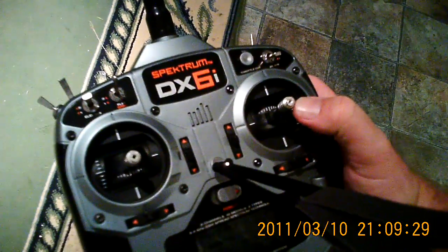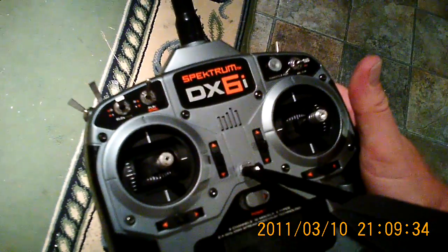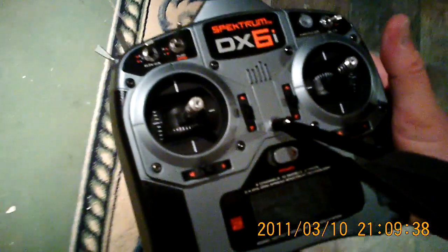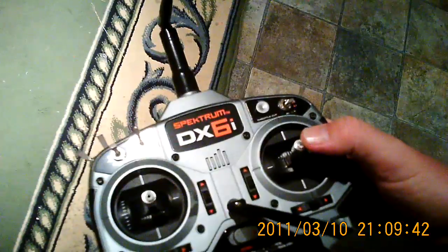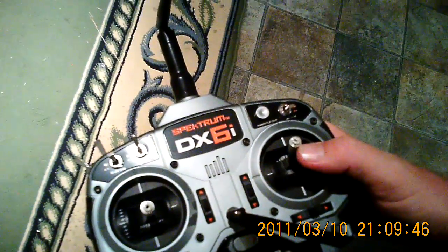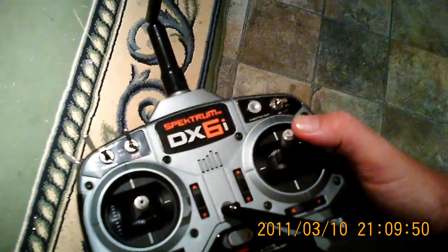Normally if I move it any higher, the helicopter is going to climb. And if I pull it back to about half, the helicopter will descend. So from a hover position at about head height, once I run the video, what I'm going to do very quickly is pull the throttle back to about the 25% position and then immediately up to 70%. Ordinarily, the helicopter would climb in that position.